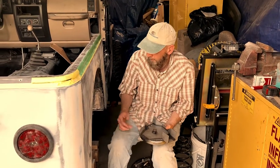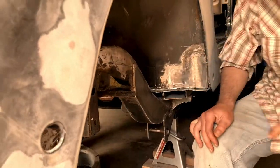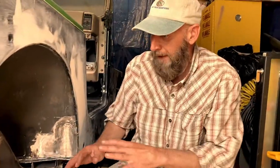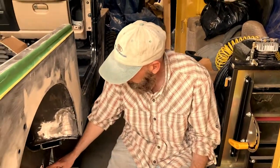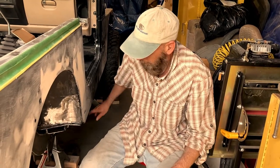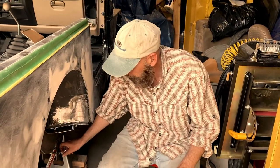My biggest issue coming over here is when I took the isolator off, I found holes all in here — it's kind of weak. So I figured since I cut everything else apart, let's finish this off. I've replaced everything: the back brace, the back horn, the arms, the center. Basically this is all cut apart so there's really nothing 100% original to measure off of. I know this piece right here on the other side is 100% correct because I squared it off — squared it off 69 times, like Ronnie Mac said. So I know this is squared off.